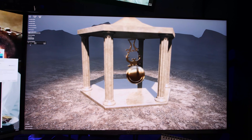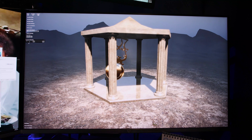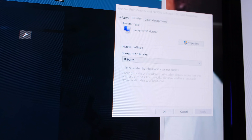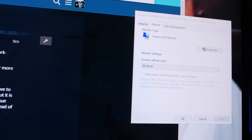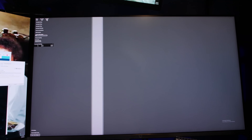The question is, how does it work with the G-Sync compatible thing? They're not officially on NVIDIA's list, but it actually works really well using the pendulum demo all the way down to about 20 to 22 FPS, all the way up to 60 FPS. The critical thing with this monitor is that you set the refresh rate to 60 hertz and not 59 hertz. The DDC EDID information the monitor advertises to the computer is like 29 FPS, 30 FPS, 59 FPS, and 60 FPS. You want to make absolutely sure the monitor is set for 60 FPS, because if you don't, you're going to get tearing around that 59-60 FPS mark. I was thinking I was going to have to use CRU to change it, but nope — runs great.